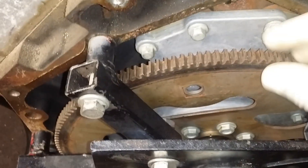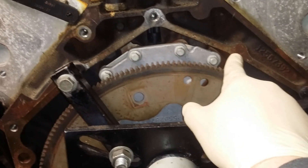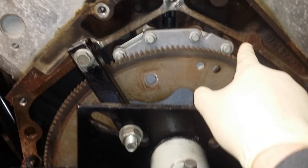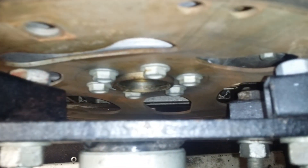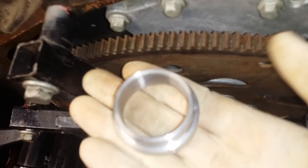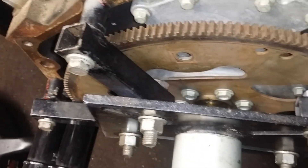Open it up just a little bit so you can get your bolts through for the torque converter to the flex plate. Put some blue Loctite on the torque converter bolts and torque them down as you're supposed to. Also note: you only use five of the six bolt holes for an older transmission — the sixth bolt would go right into the water jacket cylinder. That's pretty much it. An older GM automatic transmission to a dished LS flex plate — that's all you need. $22 to $25. Look it up on eBay. Enjoy the rest of your Sunday.